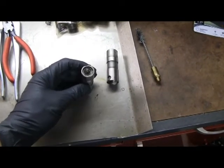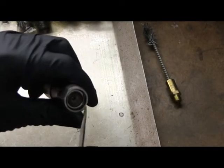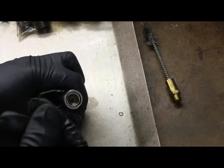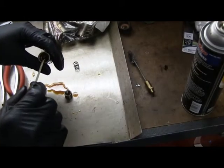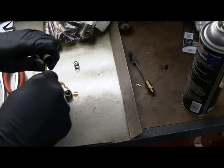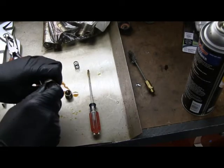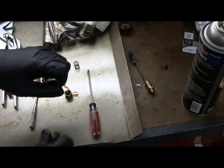For an LS, it's really easy to make a hydraulic lifter into a solid lifter. These are my old lifters here and that's what I'm going to use. I'll convert two of these over. First step is to get that little spring clip out of the top — comes out real easy, just get a little screwdriver, get in there and pop it out. Then the cup should come out. The next step is to get that plunger out. Take a small screwdriver or a little pick and try to hook it and pull it out. There's a lot of suction on this thing. Get it out close, then use a magnet to pull it the rest of the way out.